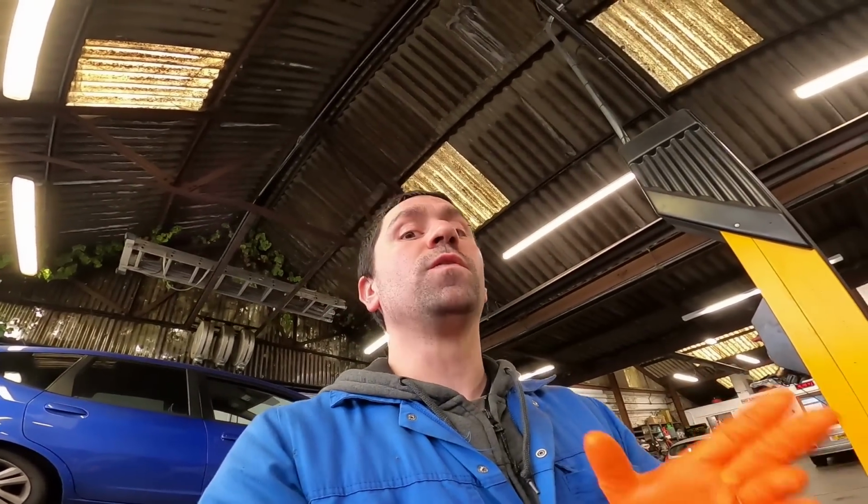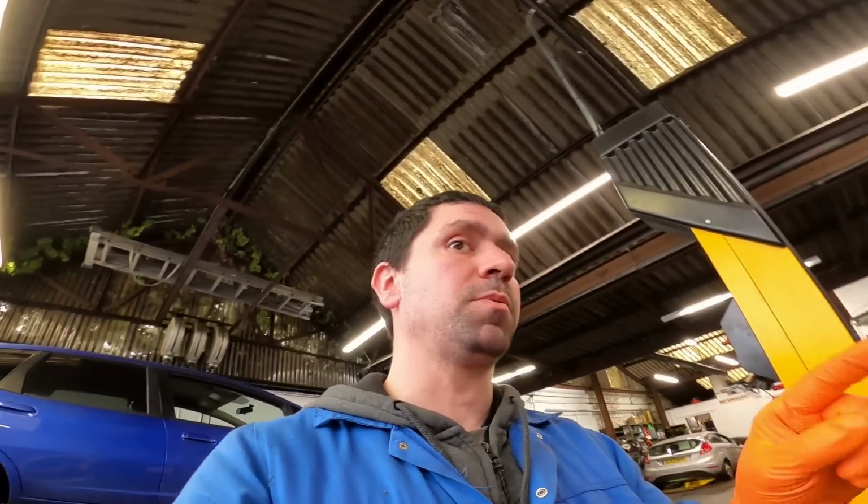So he says you get a little bit more power because obviously you're running a higher voltage, but anything over 57 volts, the standard module has a bit of a freak out because it doesn't know what to do. So that OBD plug overrides the module to tell it to stop shutting the car down. And he said when the state of charge drops back below 57 volts, it will be absolutely fine. I'm not explaining myself too well here. So when the car's fully charged, it will be 70-odd volts, and on the dash it will say stop, although the car will still drive. As I drive and the voltage drops below 57, it will then drive better and the stop light will go out. But yeah, I'm intrigued to see how far I actually get.